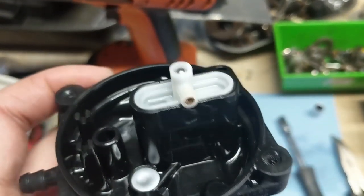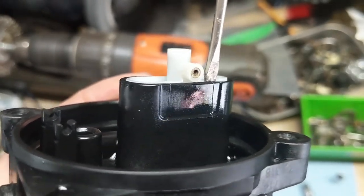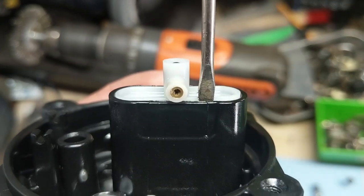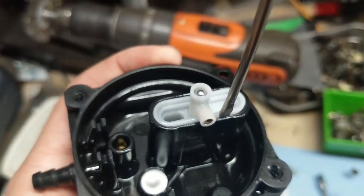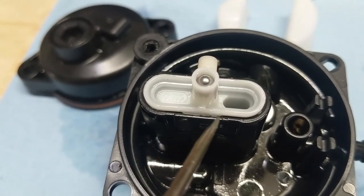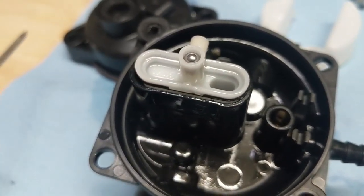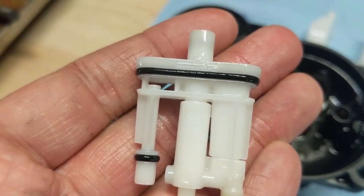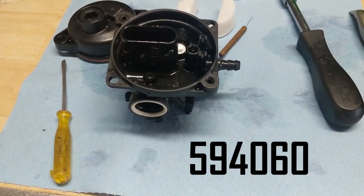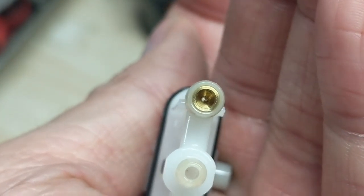We know the main jet was clogged, but there's also a distribution tube underneath that's part of the white plastic assembly. There are little indentations on both sides of the black plastic that help keep this main jet distribution tube assembly in place. Use a small slotted screwdriver, push it in between the white and black plastic, and pry that out. Go close to the center tab — that's the strongest part. You may end up damaging the little black o-ring that makes the seal, but you can replace that. I'll put a part number in the bottom right of your screen and in the description below.